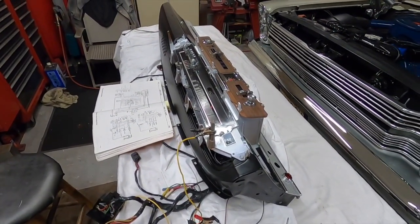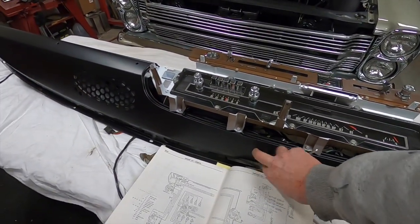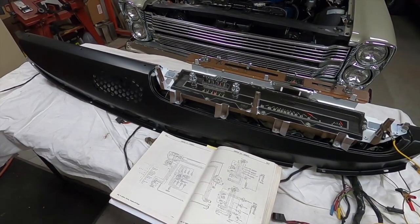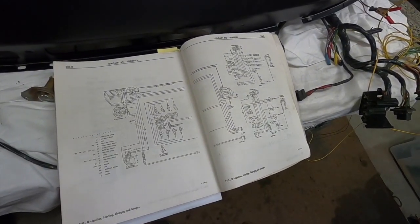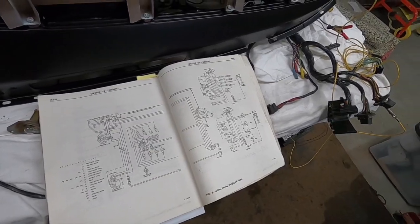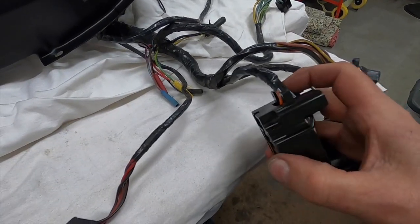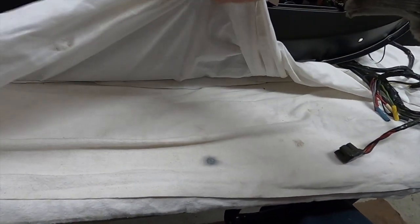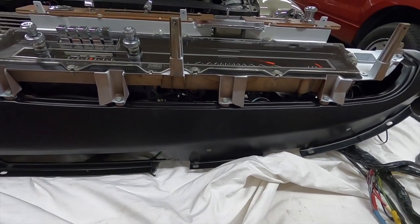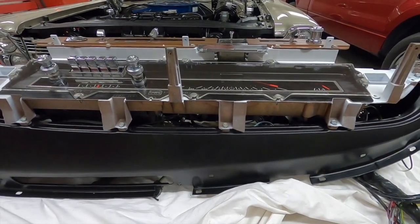The wiring harness is installed, and I think next will be the steering column coming out of the car again - for the fourth or fifth time maybe. I'm going to do the pad just before this panel goes in the car so it's not sitting around. Just get the wiring schematics out and trace what colors do what and what terminal on the connector. That little tab I found earlier - I found where it goes - it goes right here, and when I find it, it's probably underneath the sheet somewhere. I'll take the sheets off when I take the dashboard out.